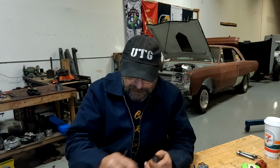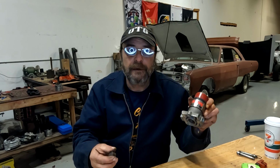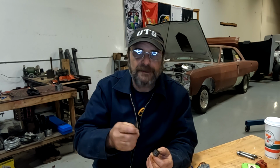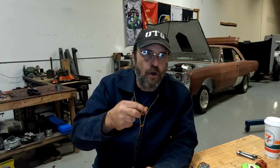But yeah, if you've got one that comes apart really easy like this, so it's not making the noise it's supposed to, or you've got no fuel pressure at all, and you pull the bottom of the pump apart and you've got one like this, you can save it. If it's any worse than this, or if you actually have to dig the vanes out, just throw it away, because they sell repair kits for these things. They'll give you a new rotor and new vanes.